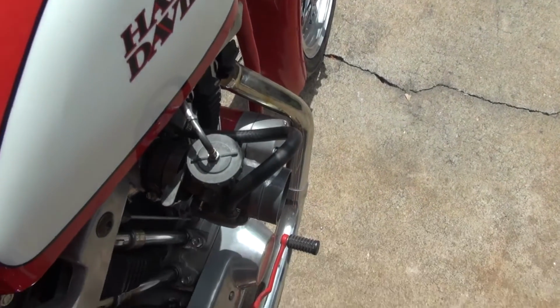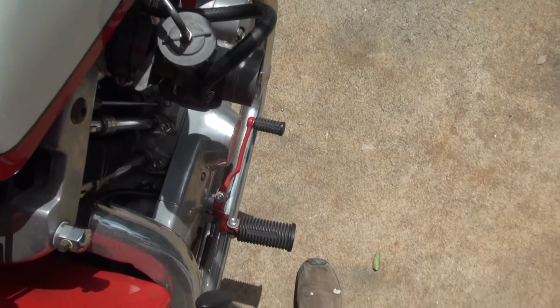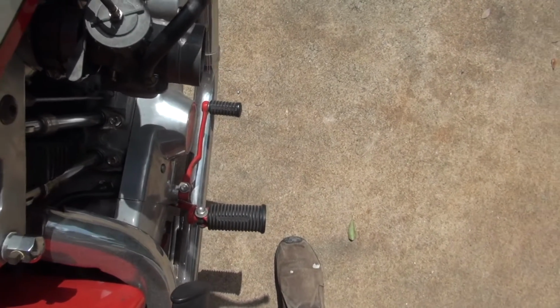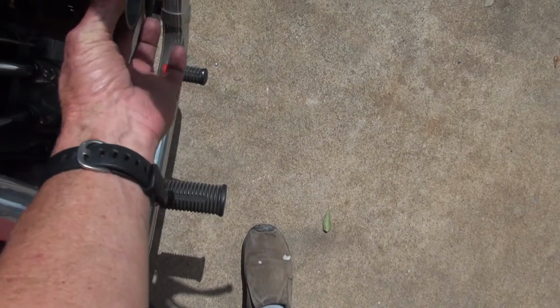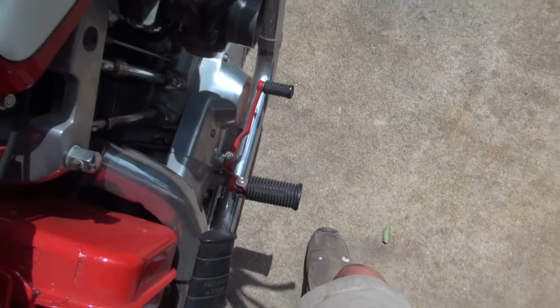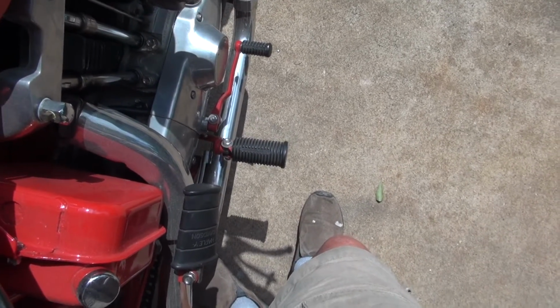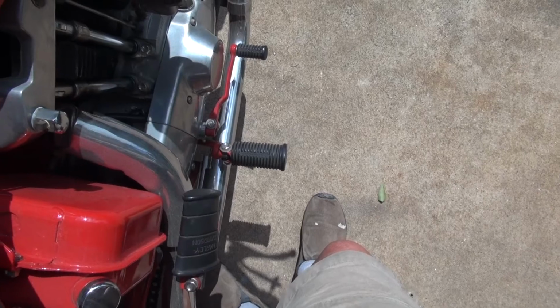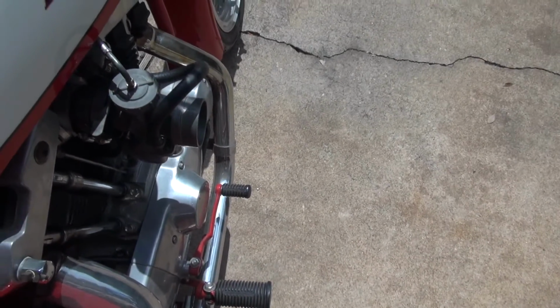And looking down on the carburetor, you can see the sun is so bright. You can see it sticks out a ways. But here is a lip, and I'm going to make an adapter, an aluminum adapter that's going to clamp to this, and it will come out and it will have a flange face on it with three screws. So I want to use the backing plate off the Bendix air filter. That way, if I change carburetors out, I'll have a minimum hassle of dealing with the air cleaner. So that's what I've got left to do, and then it's done.